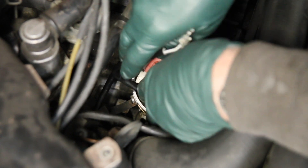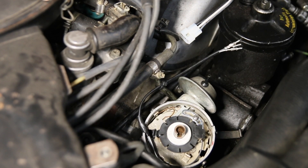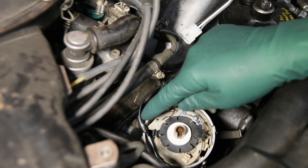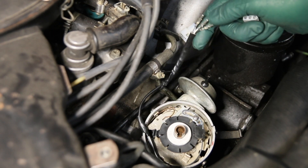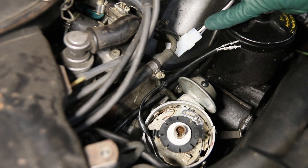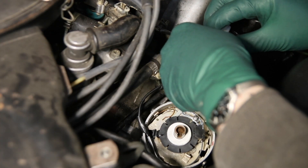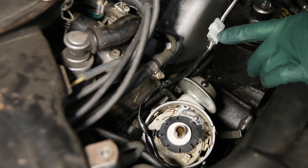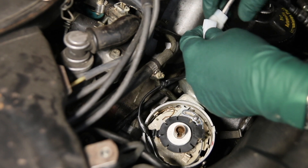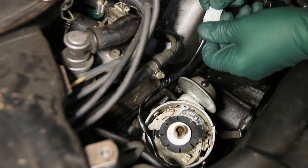Route the wiring out through the hole in the distributor housing and connect the plug. It's very important that you match the colors of the wires. The plug connector came pre-disconnected from the three wires so you can thread it through a hole in the distributor before securing it. The wires are black, white, and gray — match black, white, and gray. Push them in until they lock, then plug it in and make sure it locks.